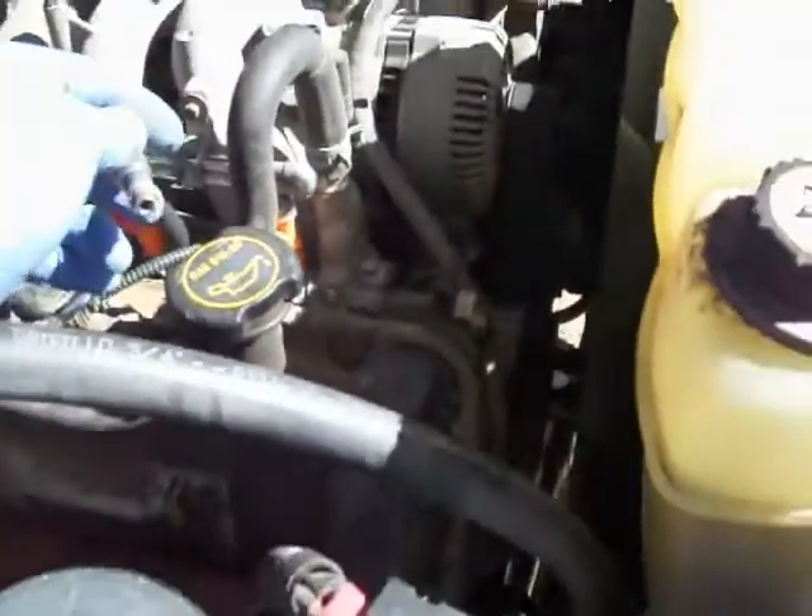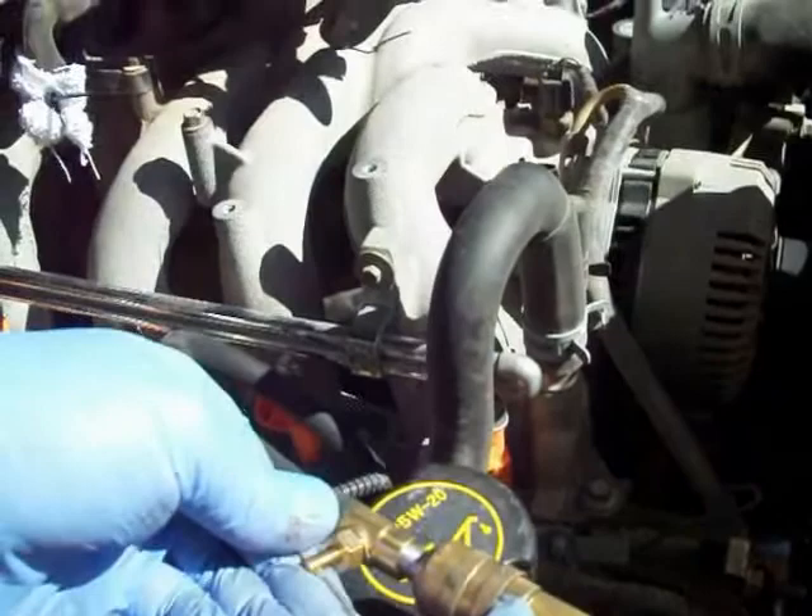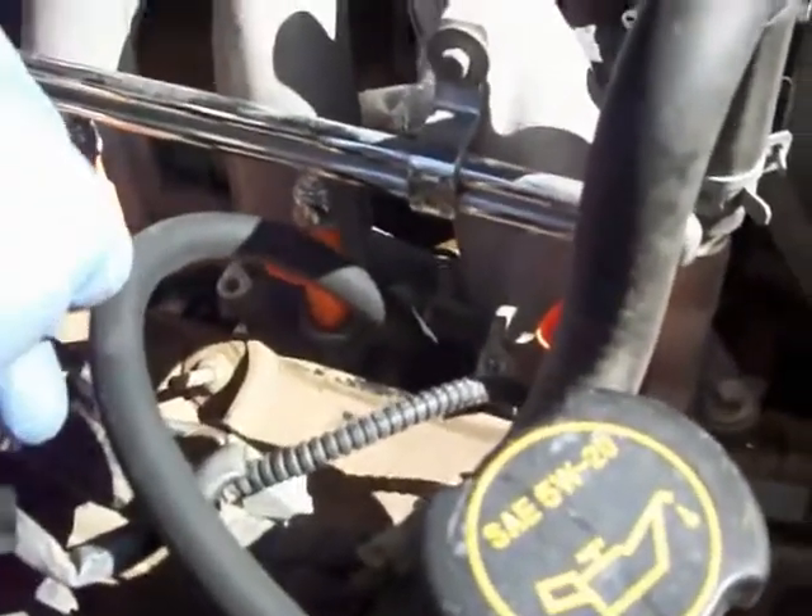Let's see if I can do that. Reach down in here and get it kind of seated in the spark plug hole. Then hook up the air line to this little tool, get the valve turned on, and what should happen is it should pressurize up that cylinder and pop out. It sounds like I'm leaking air down around there — it's so tight it won't even stay in. As soon as I let go of it, that cylinder's sealed and it does not want to keep that little plug in there. Every time I do that it just pops right out.